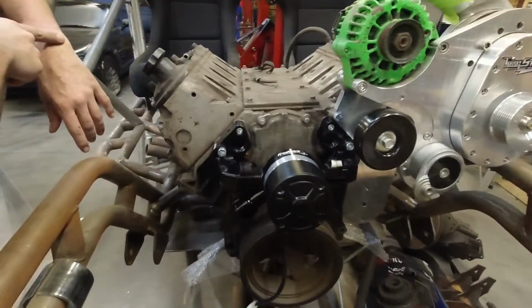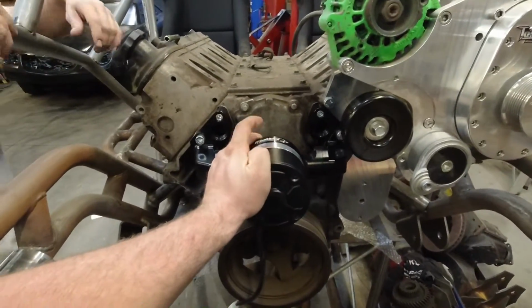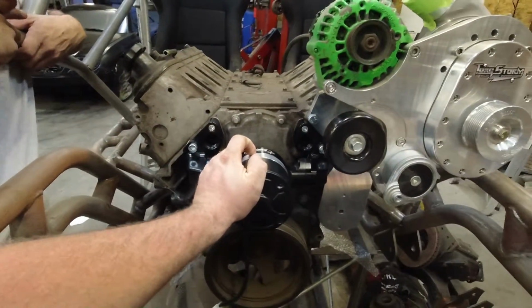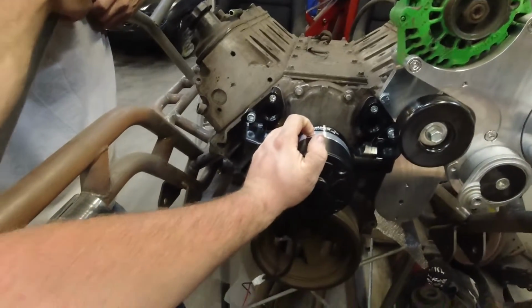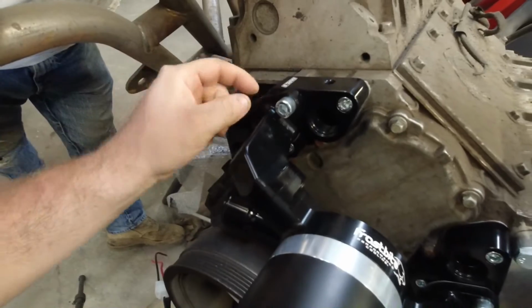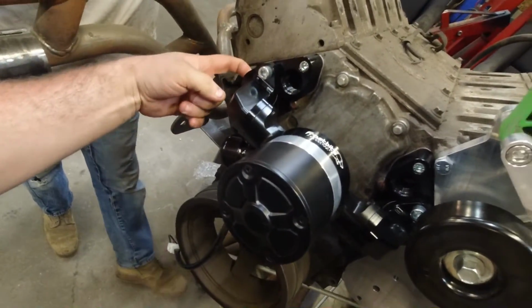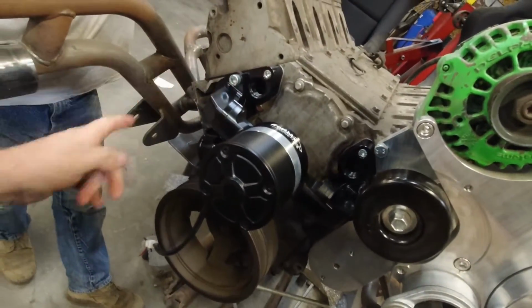I'm not sure. I've already determined that I like how small it is. We are going to have to put it in the race car and double check belt routing, but as a whole, it's pretty straightforward. Standard gasket back here, regular, it has a felt gasket. It's probably just a standard big block gasket for the water pump that you can get at parts stores, I would guess.